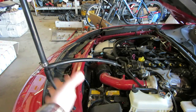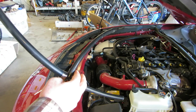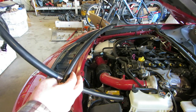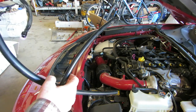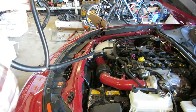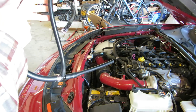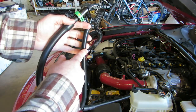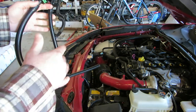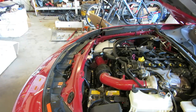If it's not more difficult to blow through the bigger hose than either of the two smaller hoses, the problem is almost certainly that the T connecting these three hoses is installed backwards. If that's the case, just remove the hoses, flip the T around, put the hoses back on, reinstall the clamp on the side of the big hose, and that should take care of it.